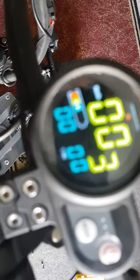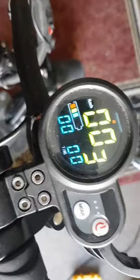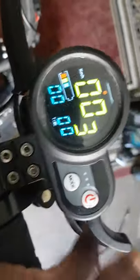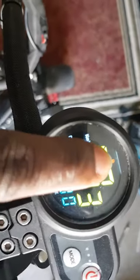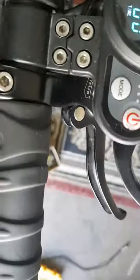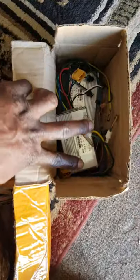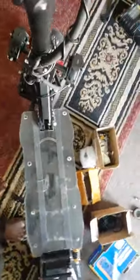Each time you put the scooter on, you're going to see a specific sign on the display. That sign should only come when you're riding the scooter and holding your brakes, but you can see that the brakes are not being held and the sign is still there. My first diagnosis when you have a problem like this — the first suspect might be the controller, because usually they control the whole thing. So I decided to have a look at the controller and bought a new one, but after changing controllers I realized the problem was still the same.